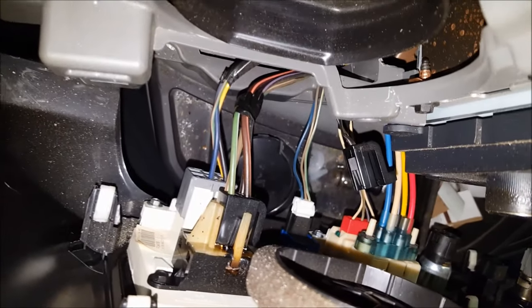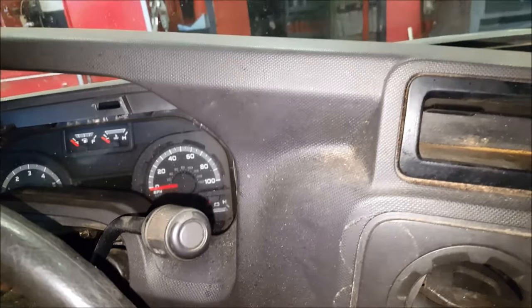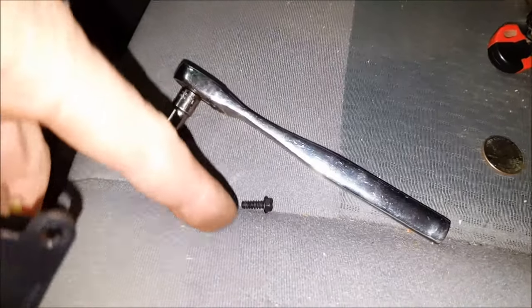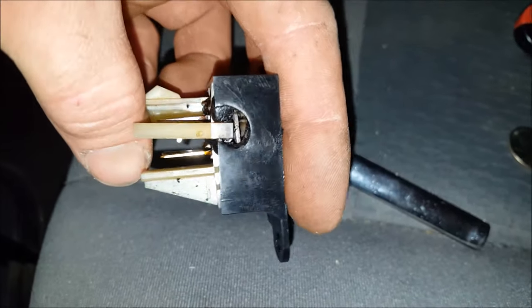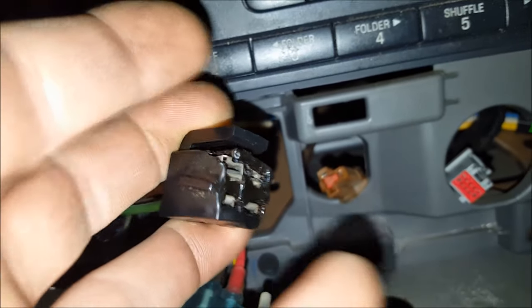They didn't really give you a lot of wire length, so it is tough. You've got to make sure these are in a neutral position and you can't be tugging on them when you push these connector tabs in, because otherwise they'll never come off or you're going to break them. There was also one up top here. And then this kind of gives you enough room to get back here. We can see that the piece is actually melted down there. It might be a good idea to take this bezel off the steering — that's going to have three Phillips on the bottom. It was definitely a little bit of a bear to sneak this past there. That was a quarter inch screw holding that on; I used a ratcheting wrench from the backside to get to that. You can see this switch is melted pretty good internally as well — you could kind of feel that on the switch for sure. And we can see the connector here has a pretty good meltdown on it, so we're going to be replacing that.